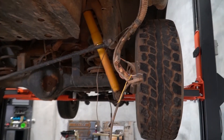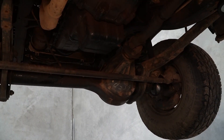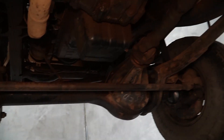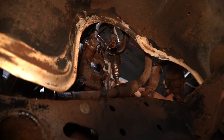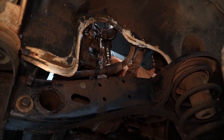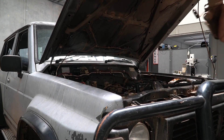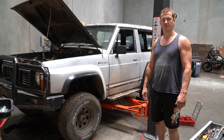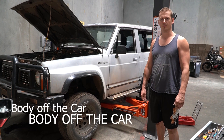So it's been about a while now. I've disconnected all the electrics from the back panels. I've done all the body mounts, I hope. That's a handbrake cable. And I think all that's left to do — the aircon's got no gas anyway, so I'm just going to take off the hoses. I'm going to have to do something with the power steering pump, which is that greasy boy. And apart from that, disconnect the master cylinder, and I think that might be almost good with the power steering pump.